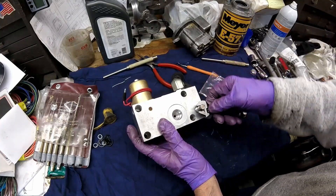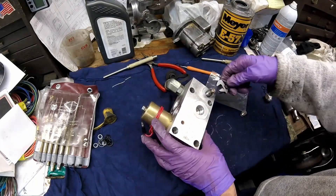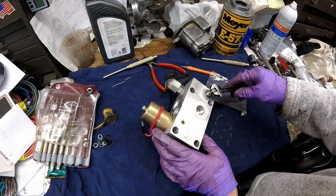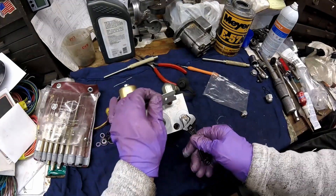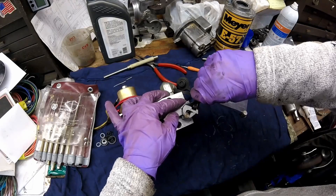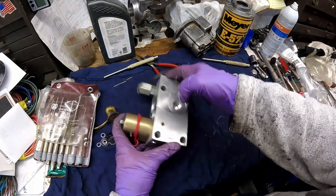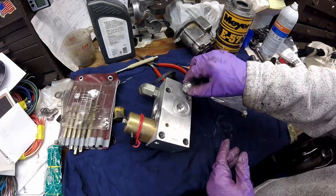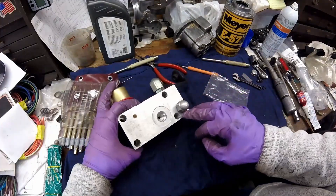I take a small adjustable and turn it in like that. Then I take and turn this down. They say the initial adjustment on this is to turn it all the way in until it stops, and then take it back like a quarter turn at the most — they say the width of a razor blade. That bolts all the way in and I take it out until I can slip a razor blade in there. It's a little over a quarter turn. Now we're going to put the cap on. Cap gets a new O-ring. You don't want to over-tighten this cap — people have a tendency to over-tighten them. These are known to weep a little bit of oil.